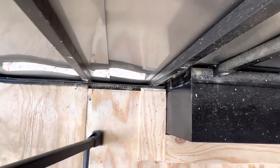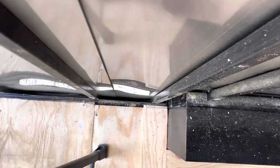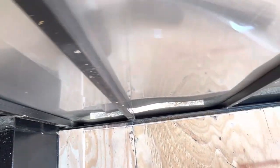This is what I was showing you on the outside — this is the back of your diamond plate and that's where the sheet metal ends. They caulk the whole bottom so that anything that does splash up from the road — because this is right behind the wheel well — will not go beyond the plywood, since it's all caulked all the way around. But again it's not pressure treated lumber, so eventually it's just going to start rotting.